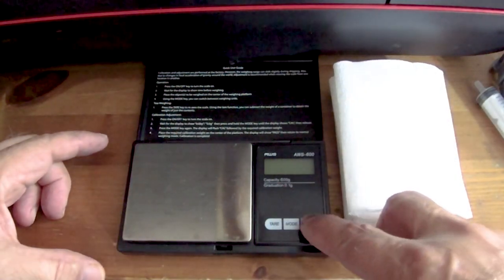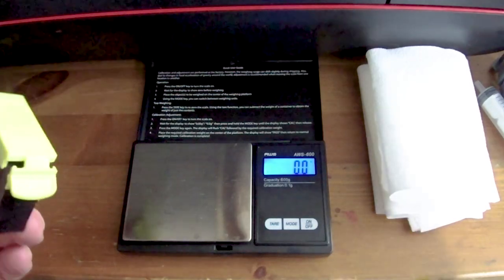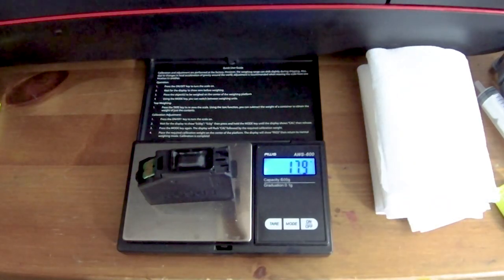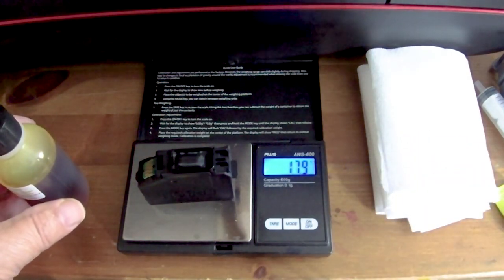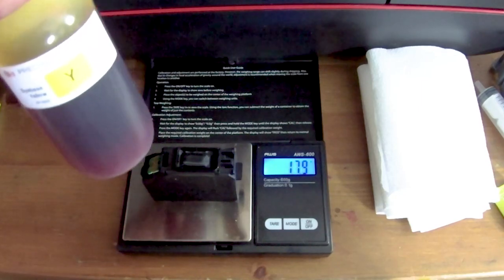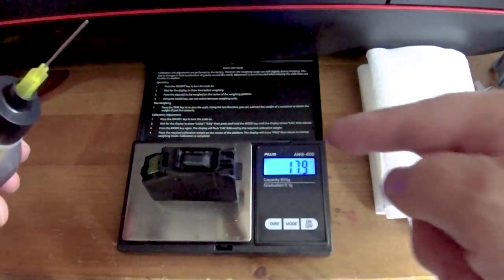Let's turn on the scale and let it zero itself out. It's set to grams. We begin with the yellow cartridge first — you should always begin with the lighter color and then work your way to the darker colors. Remove the clip. I have my refillable cartridges installed on the printer at this moment so it can sit there unattended and I'm not exposing my printhead to air. We are reading 17.9 grams. Precision Colors tells me the full weight should be around 25 grams. Make sure you double and triple check — yellow and yellow. We're going to add ink to the exit port and monitor the weight.